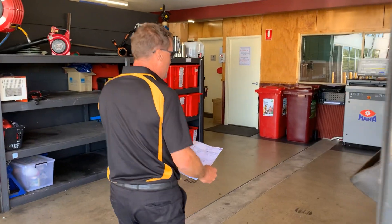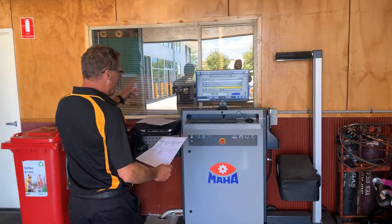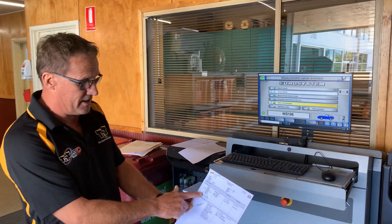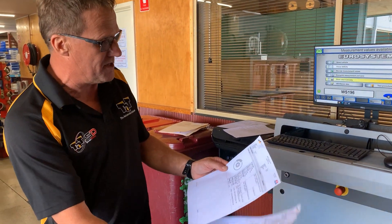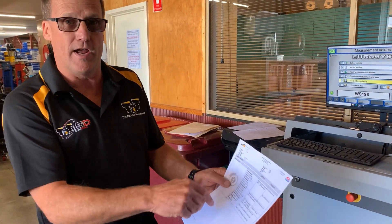You give your customer a report. The report that comes on the vehicle — we go up to the main booth here — will have the main report that comes out for this particular vehicle. First up it'll check the slip or drag of the car. It'll then check the shock absorbers front and rear, give you full comparisons. It then does the front axle, rear axle, parking brake, etc., and also the disc thickness variation on the front rotors.